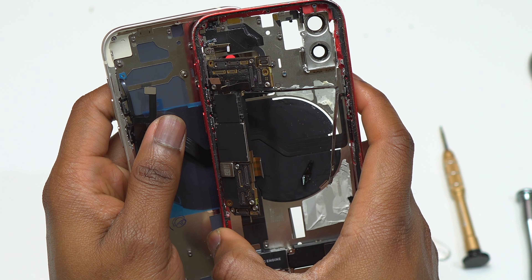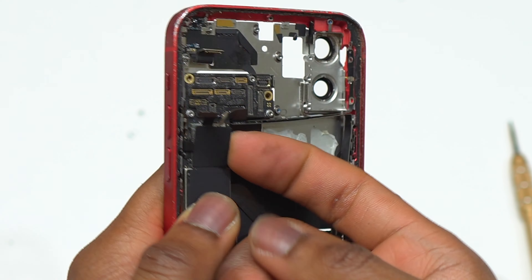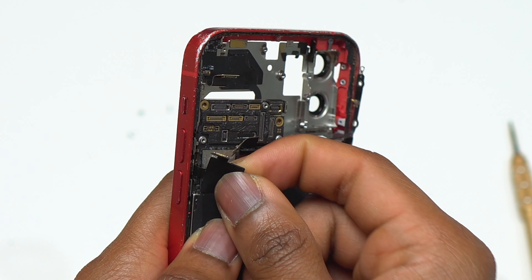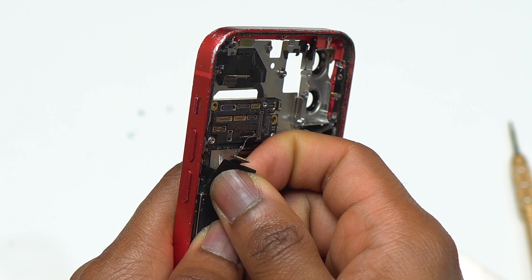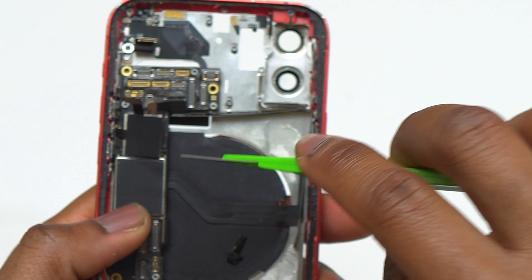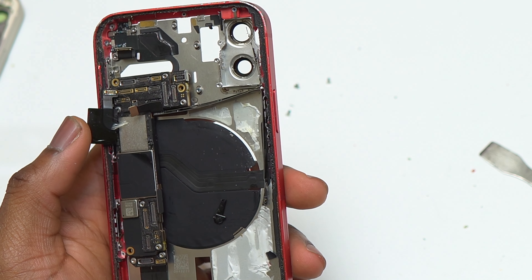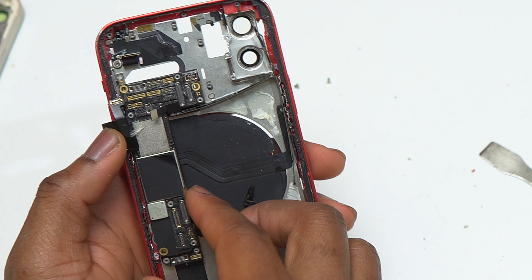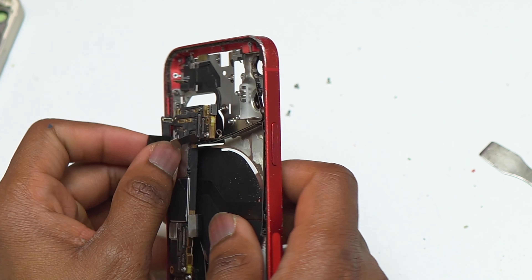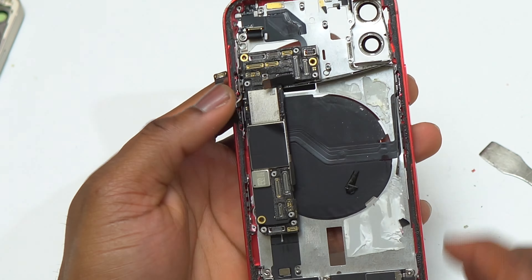There is a cable below the motherboard that should have been disconnected before working on the right side. Also, at the top there is a plastic portion covering the flex cable for the buttons on the left of the device — after removing that plastic, disconnect that flex cable. I recommend disconnecting those two flex cables before removing the screws at the right of the device; it makes motherboard removal easier and safer.